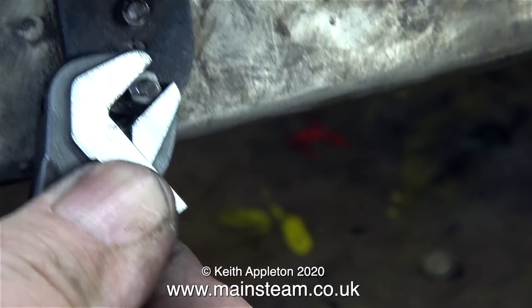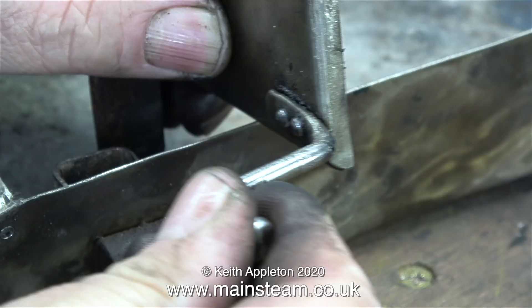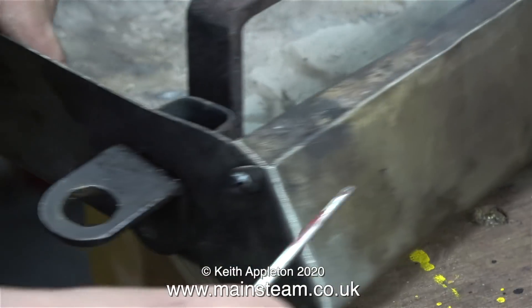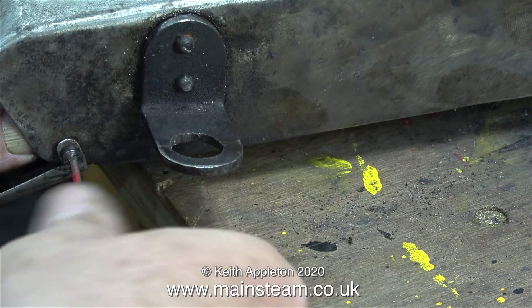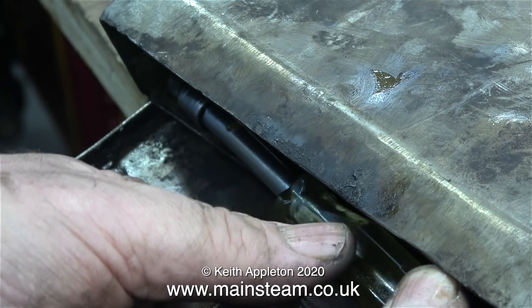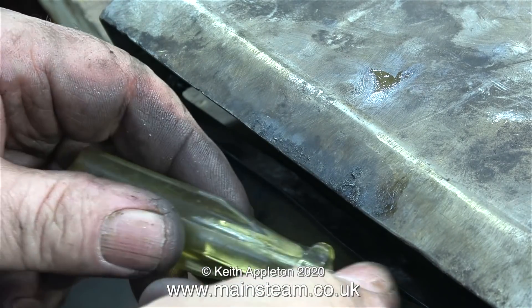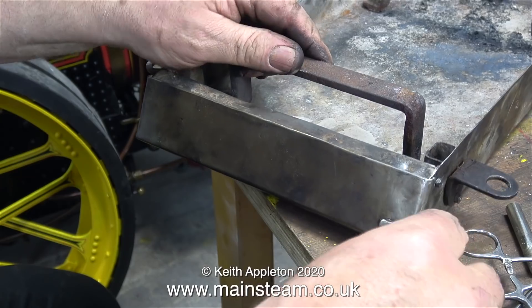After fitting a bolt to the mounting bracket it's time to look at the damper arm. To fix this I'm going to use a rivet snap held in the vise and just hammer the rivets over on the inside. I've drilled holes of one-eighth of an inch in diameter through the damper flap and the ash pan. This clip shows me screwing the five BA bolts in position with a nut on the inside, and to make sure the nuts never work loose I'm lock nutting them as well. You really have to think ahead — if I was going down the road and one of the damper bolts failed, the damper itself could drop down onto the road and severely damage both itself and the ash pan, because the ash pan slung under the firebox is not very far from the road.